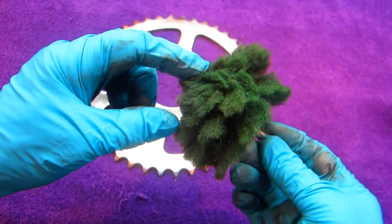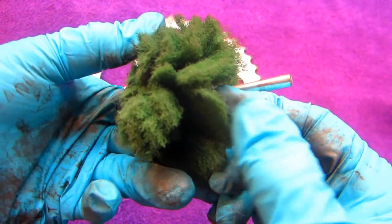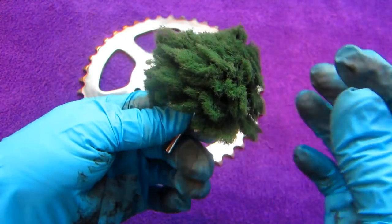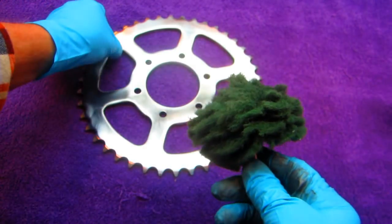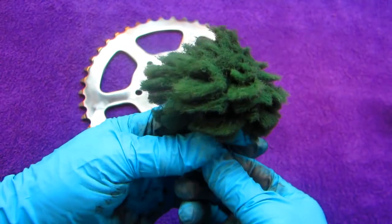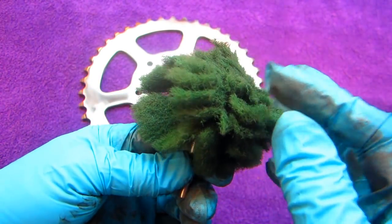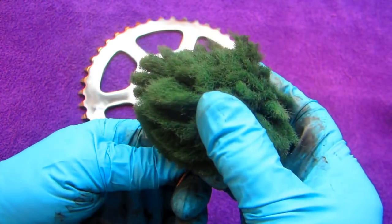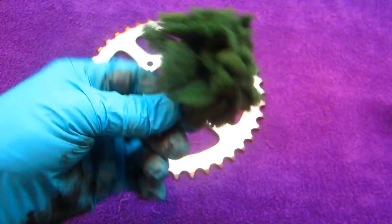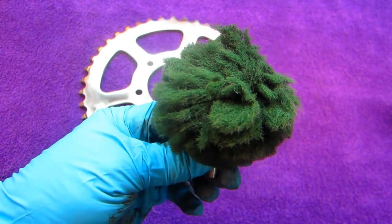Now the next step, they make these buffing balls with, it's like that material they use on a 3M pad. They make rough ones, smooth ones. The green one is good. What I'm going to do is put it in a drill press and get down in all of these little recesses. It allows me to do that pretty conveniently. But the problem with these is they wear out very quickly. These don't hold up over the long haul, in my opinion, anyway. And maybe that's because I bought the wrong one. Maybe there's a better quality one out on the market, but they do the job.